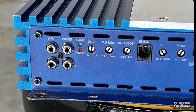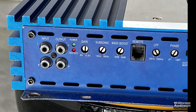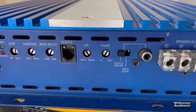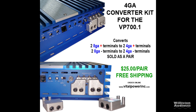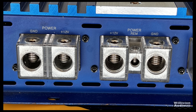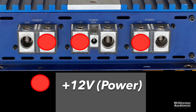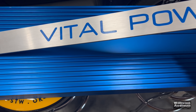We have inputs and outputs with RCAs, power and protect LEDs, gain control from 0.2 up to 6 volts, subsonic from 10 Hz to 50 Hz, bass boost 0 to 9 dB but no frequency specified, remote connection for the remote bass knob, low pass filter 250 down to 35 Hz, phase control, a switch for output master or input slave with the RCA connection for that, and speaker outputs on the right side. Adapters are available to change those 8-gauge terminals into 4-gauge for $25. On the opposite side you'll see the triple 1/0 inputs for power and ground, plus remote connections. Make sure you check very closely before hooking this up — where the power connections are and where the ground is. Don't follow the guide shown in the manual.